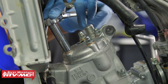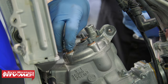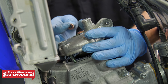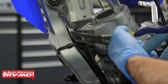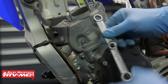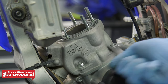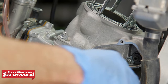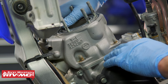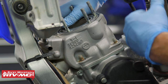Now we're going to loosen up the cylinder head nuts in a crisscross pattern, then rock the cylinder head off and catch any of the copper washers that are loose. After that, remove the power valve breather hose. Now we're going to loosen up the cylinder nuts in a crisscross pattern using a 12-millimeter box-end wrench — this one is from Motion Pro and it's designed to help torque everything when you go back together. Note that one of these nuts is located in the power valve cover.